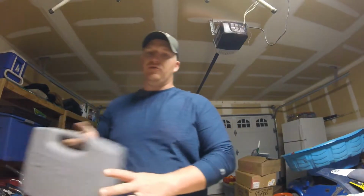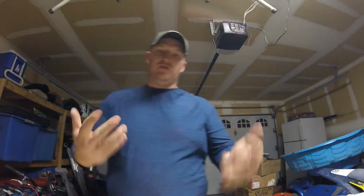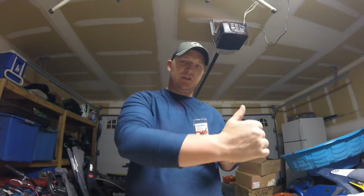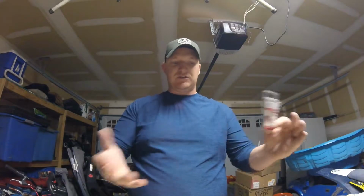You're going to need a Dremel tool. Mine is wall powered, has 10 speeds, or you can use a jigsaw. I use the Dremel tool just because it's easy. Another one you can use is a Rotozip. The reason why I say Rotozip is I bought these blades for my Dremel tool, and that's pretty much what it does. It turns my Dremel tool into a Rotozip. I've found, because I tried using the scroll saw before, that it helps you get the angles, and you can cut in radius and whatnot on this plastic. It cuts way easier. Make sure you buy a good new blade for that.